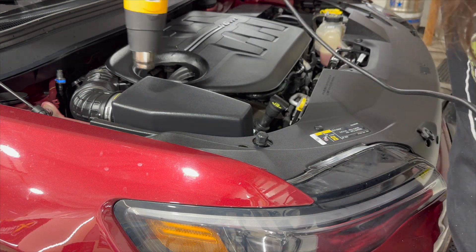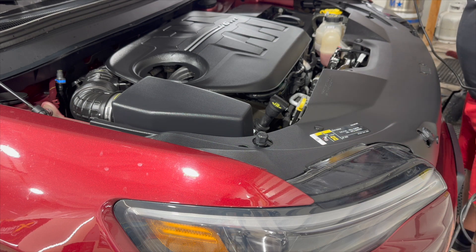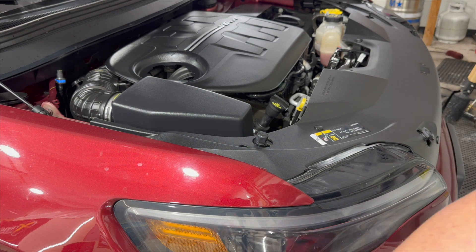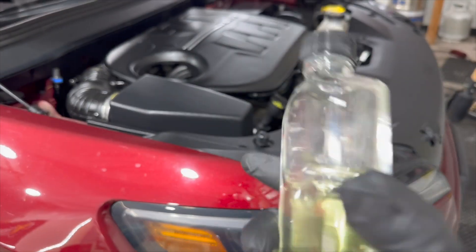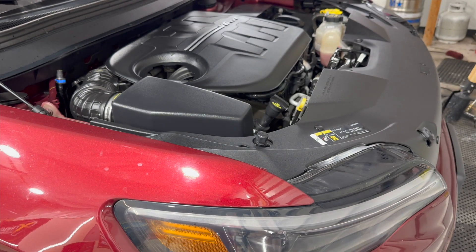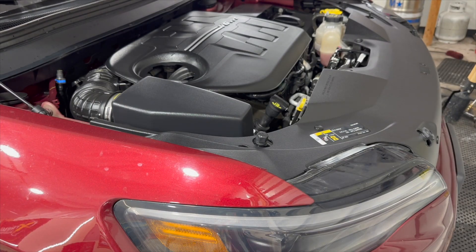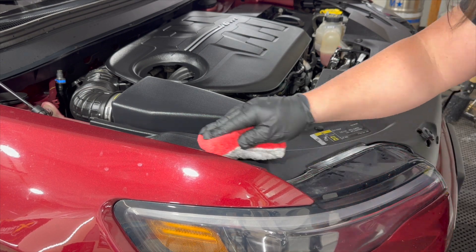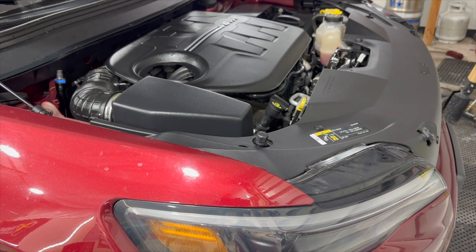The product we're going to use directly over Tac System Seal is a Tac System ceramic coating called Quartz Easy. Quartz Easy is a one to two year coating — in the engine bay, it'll probably last two years. This stuff works really great going over Tac System Seal and just amplifies the texture and look. As you can see, this isn't a brand new bottle — we've done a bunch of things with this stuff and it's great. You need to apply four, five, or six drops and just massage it in gently. There's no need to wipe it off.